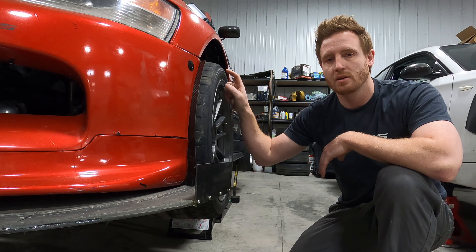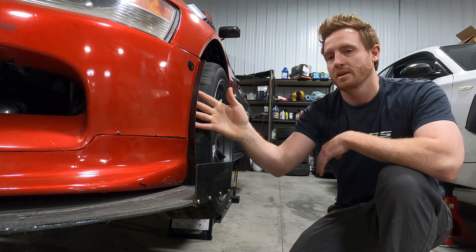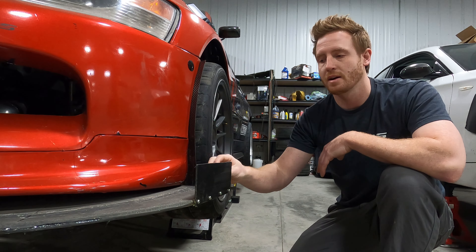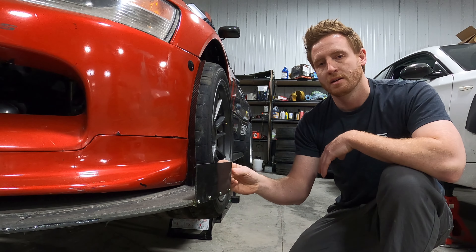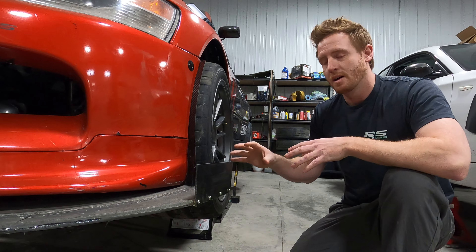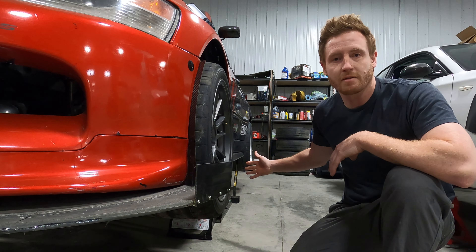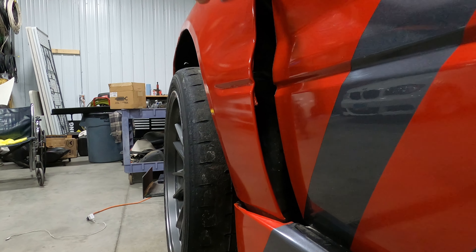Moving into the fender area, on the back of the bumper we have tire spats. These are supposed to go just to the edge of the front tire — this car is running a 295, though I normally run a 255. They help direct air out and around that tire, and also help pull air from the inside, with a side effect of aiding cooling and getting air out of the fender area. The end plates in this area help create a vortex depending on the shape, directing air down the side of the car. They'll keep air from going underneath the car and protect that low pressure the splitter is creating, blocking high pressure air from sneaking in there.